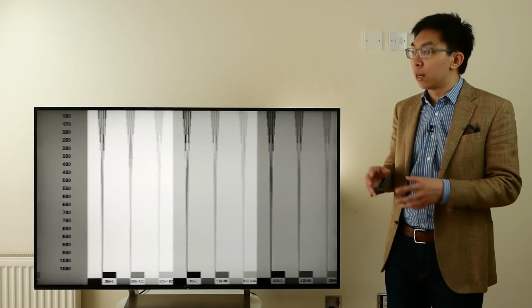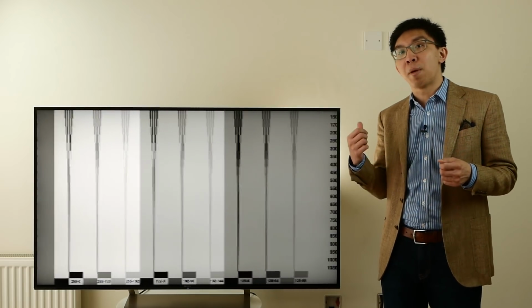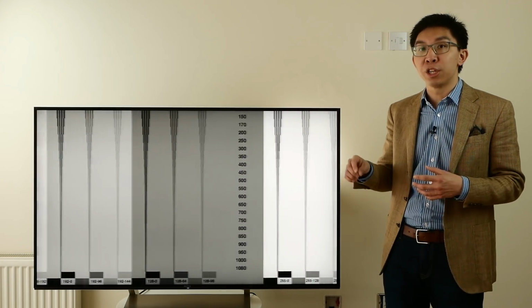In either case, the light output will be dimmed slightly because of how backlight scanning works, but you can always increase the brightness control to compensate. Also, despite the help of backlight scanning, there's no way to achieve 1080 line motion resolution unless you throw in some motion interpolation, so there'll be some soap opera effect and interpolation artifacts.